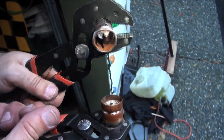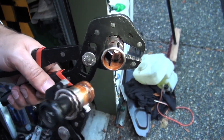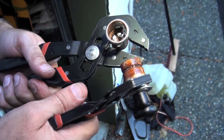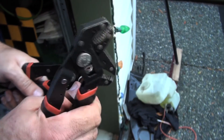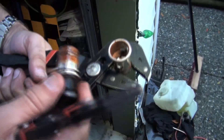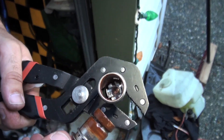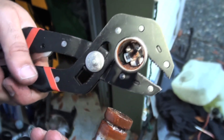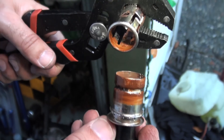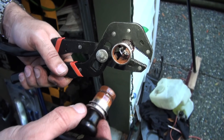You can see how degraded that is — it's amazing. But there's your problem right there. So now we have a lighter that will come apart, but we are going to have to go looking for a new one, because the contacts in there are just destroyed. In order to have a working cigarette lighter socket for an iPhone or whatever else he's going to be plugging in there, we're going to want to find a new socket. We'll work on finding one of those and then show you how to reinstall.